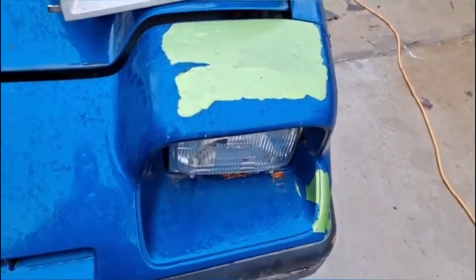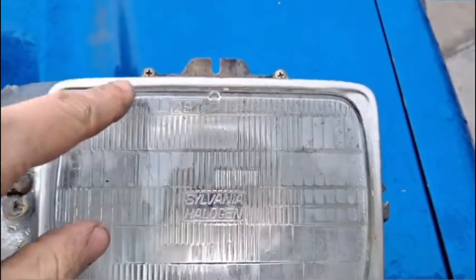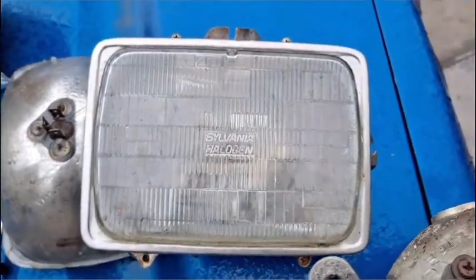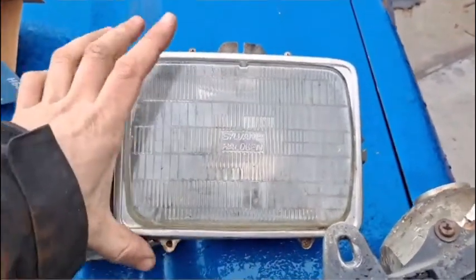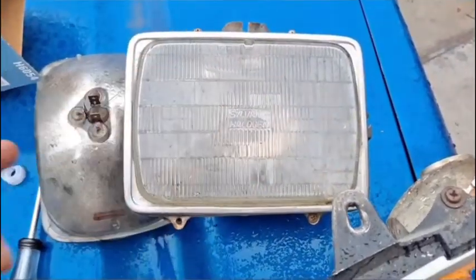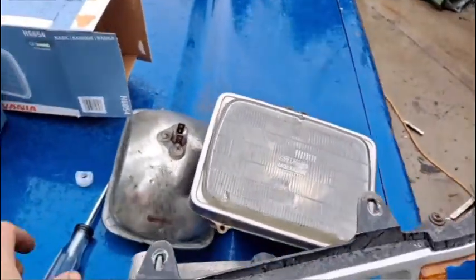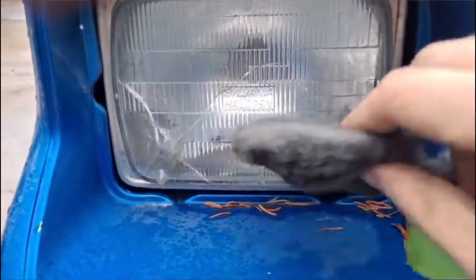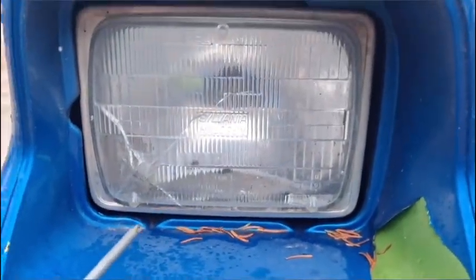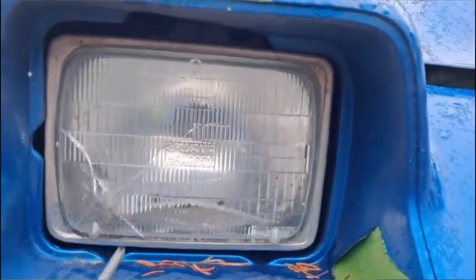To change out the bulb, all you have to do is remove those four screws. And it doesn't matter if it's the Escort, Lynx, LN7, or EXP — it's all going to be the same process. Remove those two screws and then this chrome or stainless bezel will come off, and your headlight will flop down. Let me walk over to the EXP headlight. I have a little steel wool here to clean up these stainless rings. Let me pause the camera and start unscrewing.